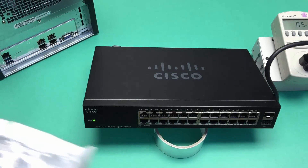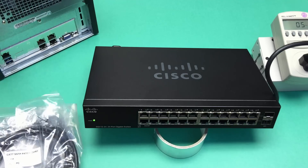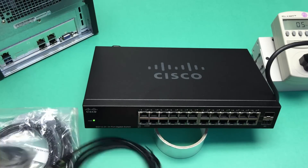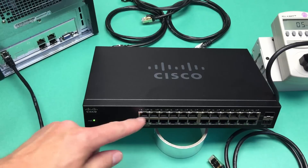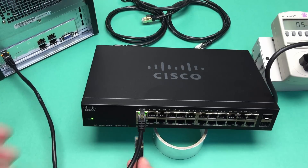I've got things set up with a better camera angle for you. I'm going to try some patch cables here. The machine on the left is going to boot to its BIOS screen — there's no OS on there right now. Cat7 patch cord, nice and short, in sealed baggies. I'm going to go ahead and wire up 5 cables. When any server PC finishes booting up, it tends to get quieter. Port number 1 is at the top left corner, so I'll go with that for management. And we have 2 green lights indicating gigabit.